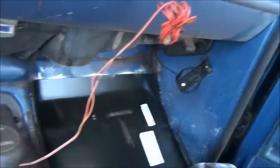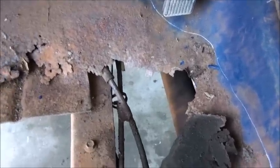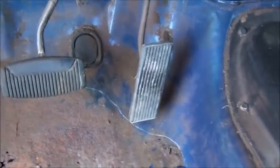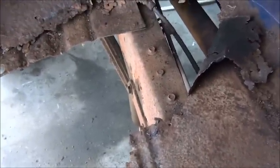I'm not going to go all the way to the top on this one — we're not going that high because we've got good metal up here, it's as solid as a rock. Pretty much from that indentation line right there, we're going to go as far up behind the pedals as we can physically cut with a cutoff wheel. We're going to come down around the gas pedal because that's solid. Pretty much from where I drew my line is solid — there ain't even any rust on it, it's dirt up above that'll wipe off. The bottom side of the panels look good.